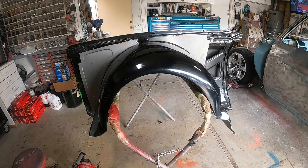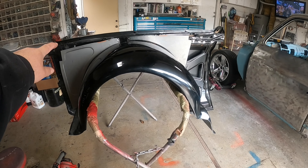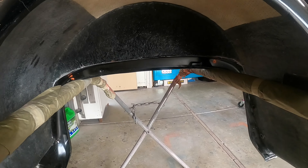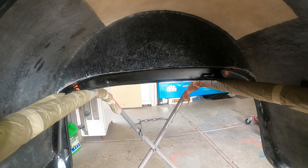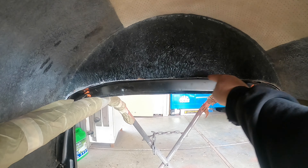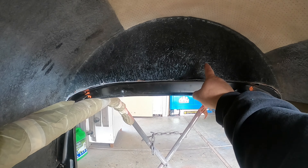This is basically what it's going to look like when the slosh tub is done and these two panels are welded back in. Down here on the underside, I needed more room for my tire. So what I've done is trimmed the slosh tub a little bit to sit on top of this lip after I've cut out the inner fender.